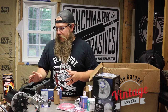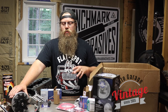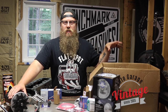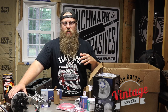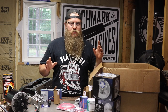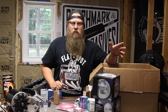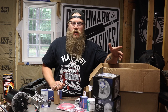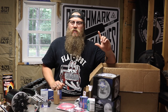The alternator is going to ground through the engine, so make sure the engine has a really good ground. If you need a ground strap, you can ask to have that included in your kit. This kit makes the whole conversion way, way easier. Make sure you check out vintageautogarage.com. Also look me up — Wired Customs LLC on Facebook, YouTube, and Instagram. I'd love to help you on your project. Let me know what you have and submit any questions in the comments below. Thank you for watching.